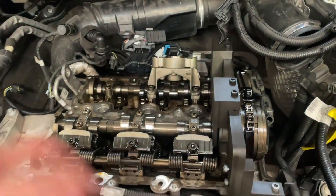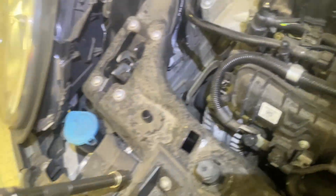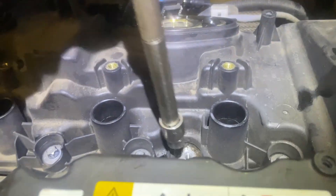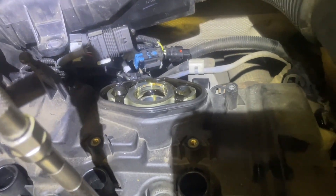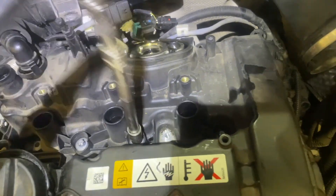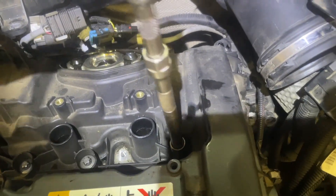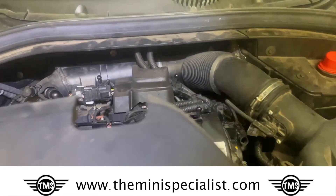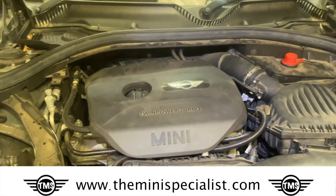I'm going to remove the locking tool, put the rocker cover on, and start reassembling the car. So the rocker cover's going on. I've zipped up these bolts with the gun, but despite that I very much recommend torque wrenching each of these individually. The reason is, even though I've tightened a bolt with the gun, I've set this to 12 Nm and I can still turn it. Because of the rubber gasket, it's very inaccurate to just rely on the gun — so torque wrench it every time. That's everything back together. I've cleared the faults, run the car up, and we're all good. Thanks for watching.